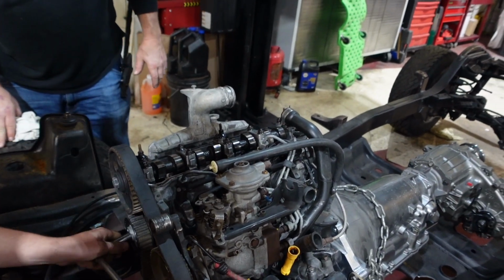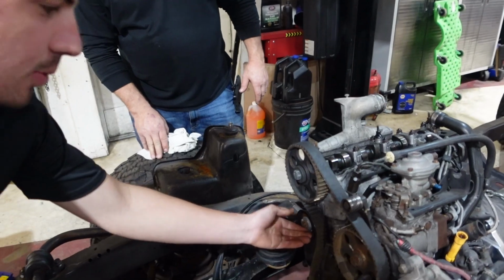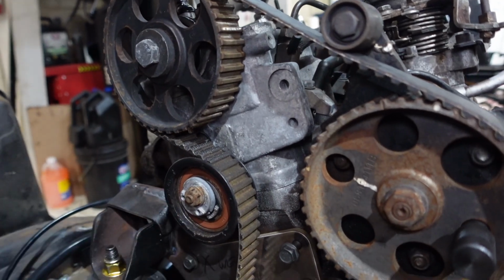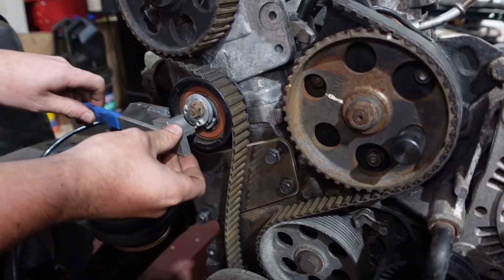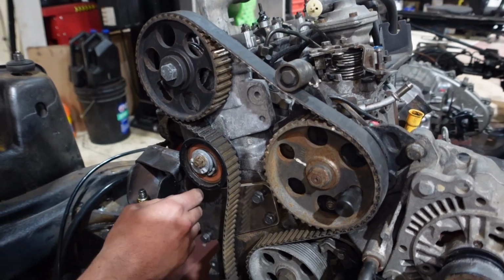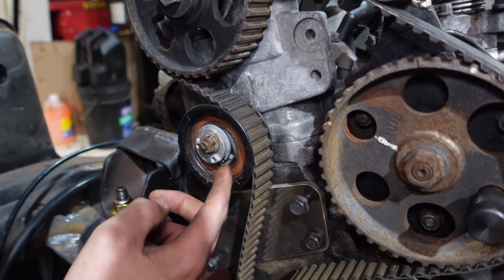The tension. Oh wow, I thought it was like a serpentine belt. This is a standard tensioner for all TDI Volkswagens. There's two little keyway holes in there. You take a tool like this, and you just tighten it, and it'll bring it around. And then you snug this down. So how tight do you go with it? So there's a little mark. You see this little arrow, this little bump right here? It'll bring it around so it's in the center here.